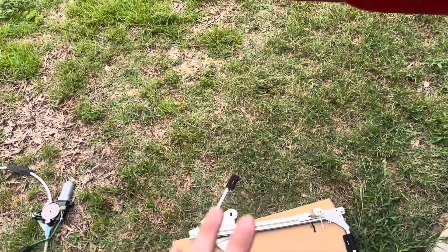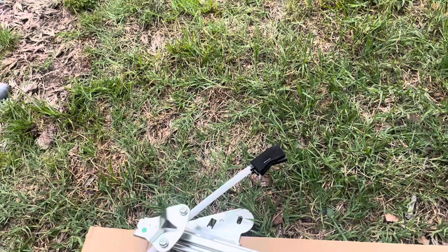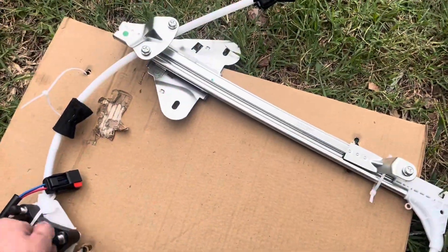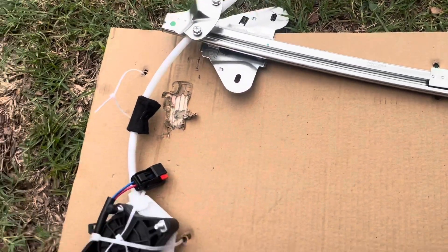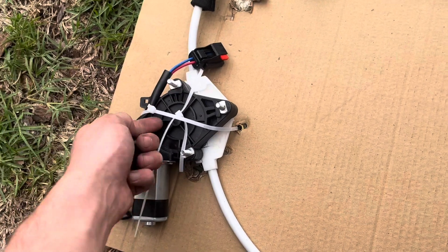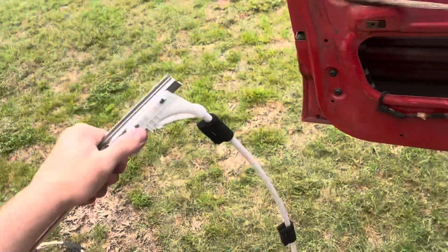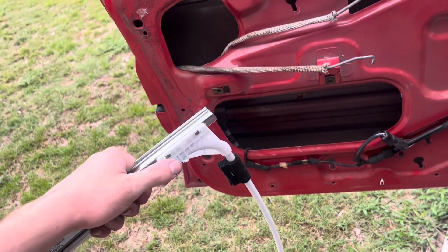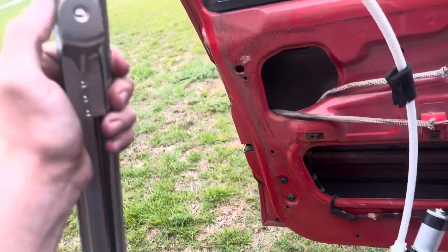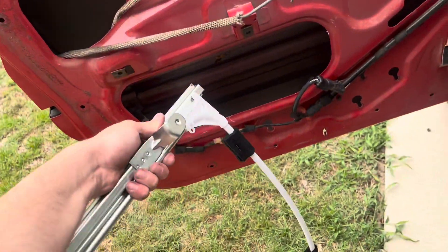Next we're going to take the old one out and get the new one installed. Mine was stuck at the top, but the new one has the window position down at the bottom already, which is convenient and will make it easier to install. They also include new screws, but they don't include the nuts for the motor, so hold on to those nuts from the original. I'll link the Amazon part in the description. I'm going to stick this in, connect it up, and show you how. I've freed up the motor and I'm going to start it from the top, stick it in there, cram the rest in, and line everything up. Make sure to take out your bolts before you stick it in.